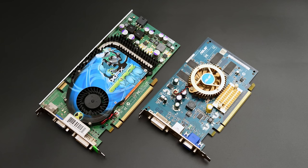Moving on to the topic of the drivers, the PCX5750 always locks up the system after the first restart following the driver's installation. The 6800GS displays artifacts after the installation of the driver. Although tested on a Windows XP machine, the card works fine. This behavior was consistent, as I repeated the installation procedure 2 times.